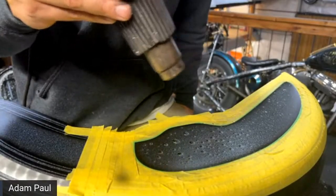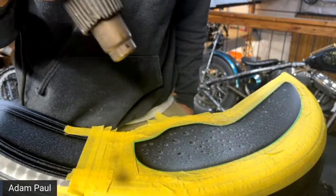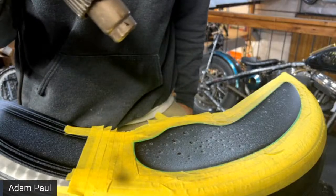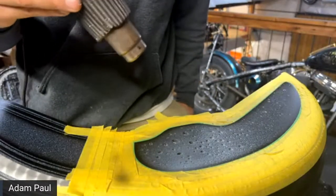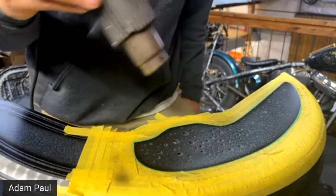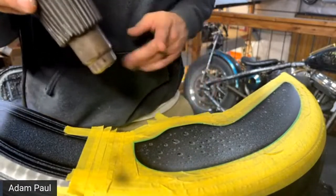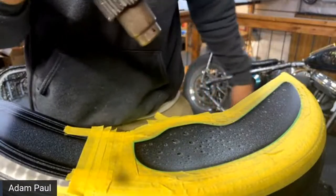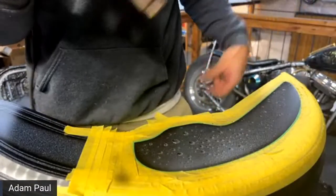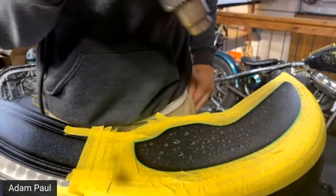And then someone said, would you do white in one direction and a dark color in the other? So I did black that's been over reduced, and then I added a clear base coat to it to make it less potent. I did that in this direction, spraying this way on the drops, and then I used a silver base coat, giving it a little bit of a highlight.